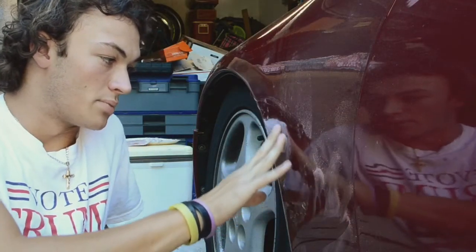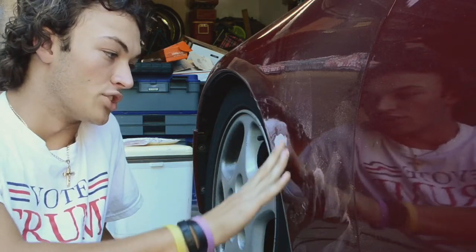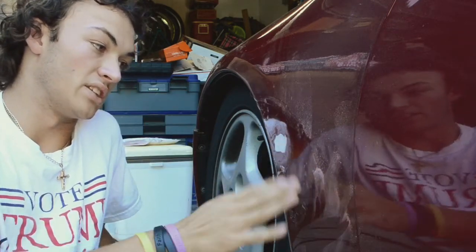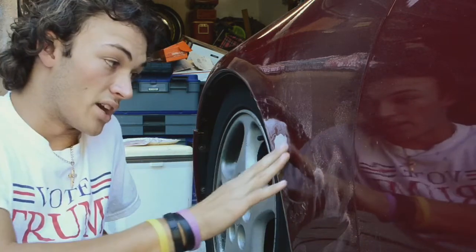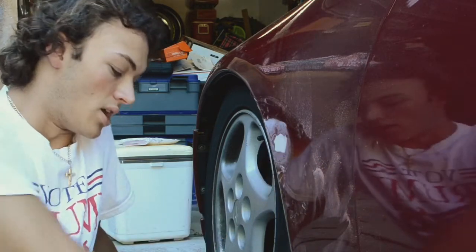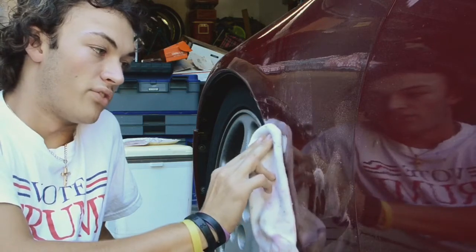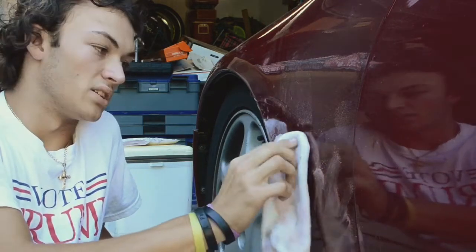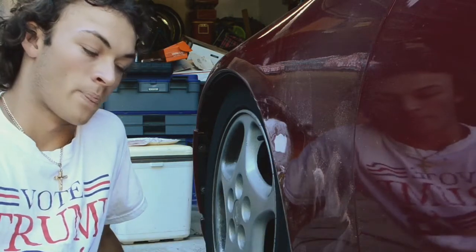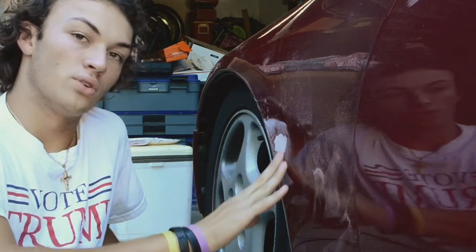So now that we've got that semi-sanded, it's pretty much just gonna be feeling it out from here. I'm not a professional, so I'm doing my best. You're just gonna want to feel for any raised spots, or on the opposite case, if it still dips in and you still feel the dent, then you're gonna need to hit it with another layer. In our case, I think we're good with this layer. The edges need to be sanded a little finer and it actually still feels raised a little bit. One tip that a lot of people do is they use a cloth or paper towel — I'm just using a sock here. You can still feel that it's raised up a little. Don't feel for a texture difference, because obviously the Bondo is gonna have a little bit different texture and you're gonna hit it with that finer sandpaper to really smooth it. Just feel over for any minor imperfections and keep working it down until you get it pretty smooth and level.